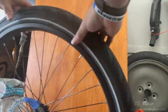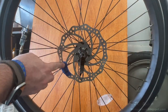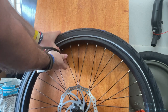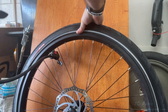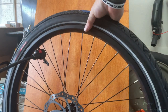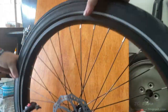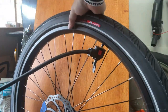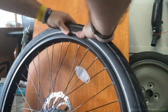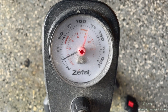I do a quick walk around to make sure everything is seated okay and verify that both rotation arrows are pointed in the anti-clockwise direction — they are. The tire is given just enough air for rigidity for inspection. As air is added, I look over the bead where it seals on the rim to make sure it's even all around on both sides. Each time it looks good, more air is added. My front tire is finished at around 45 PSI.